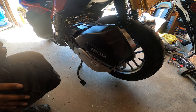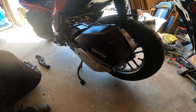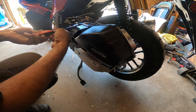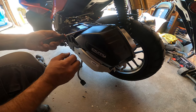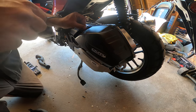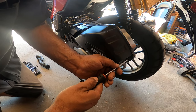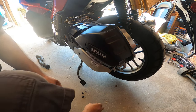Now the air box is kind of special — it's mounted through a part back here and a couple parts around the actual box itself. So what you're going to want to do is start removing the main screws off the air box. On the upside, this will pretty much drop a lot of the weight. This box with the factory filter and all that weighs a decent amount — so less weight, more speed, that's for dang sure. It is beneficial to you going this route.